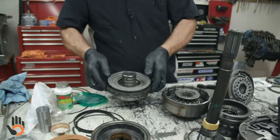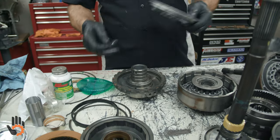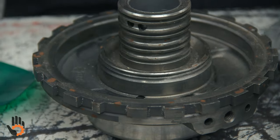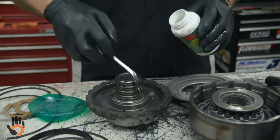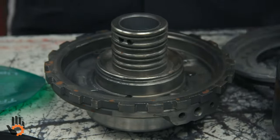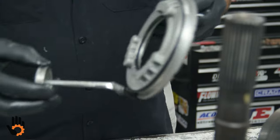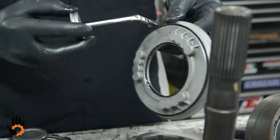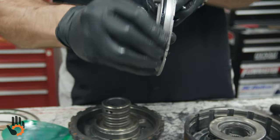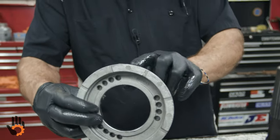Let's do the same thing with our other piston, the intermediate, both lip seals facing down. Once again, we've got to get past a snap ring groove and this outer edge. Lube them up. Now notice here, it doesn't hurt to work these down once again with your fingers. What we're gonna run into though is we cannot access that outer seal.